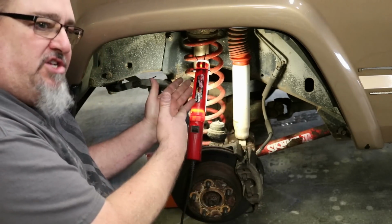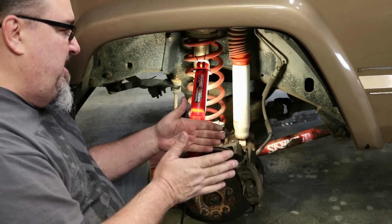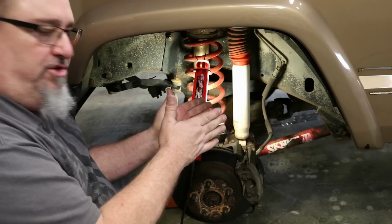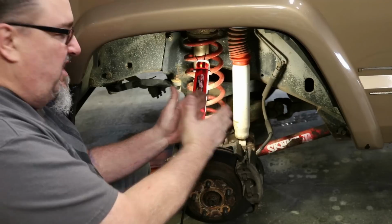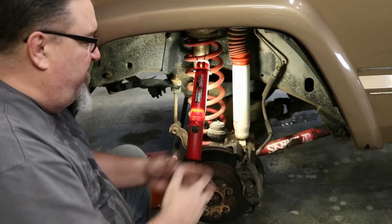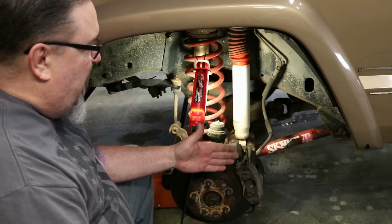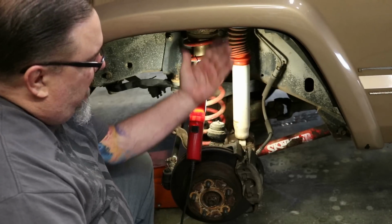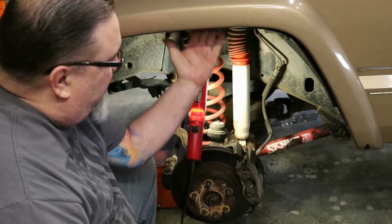You can adjust your steering stops, or you can just back off, but at the end of the day, you're losing your turning radius. So if we go with a wider stance, we can go to full steering lock without rubbing. That's one of the benefits of that, as well as the stability. But on the stock rim with a 31 though, the tire can still move up behind the fender.